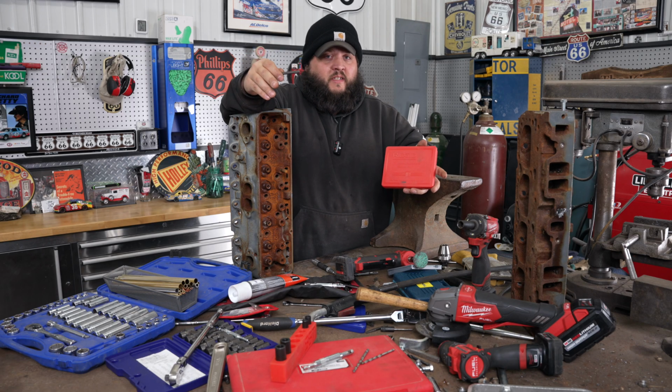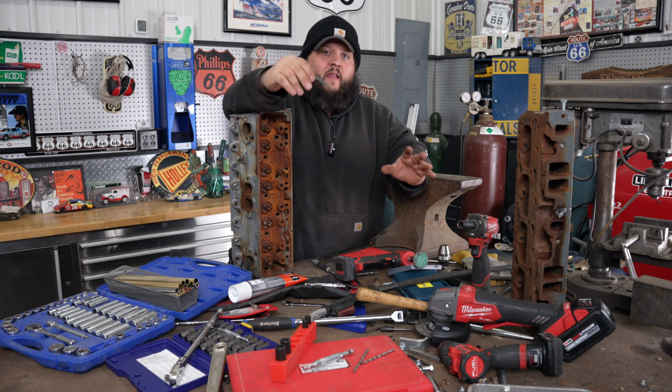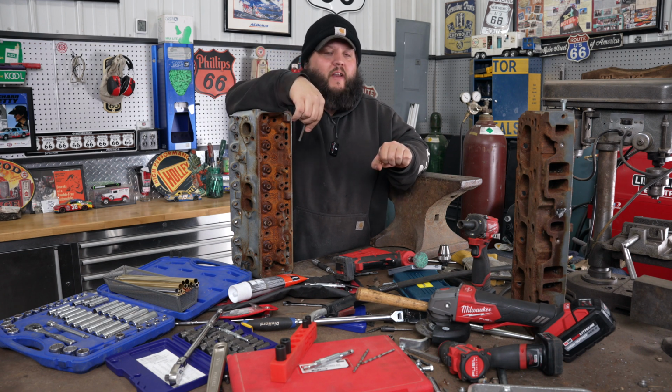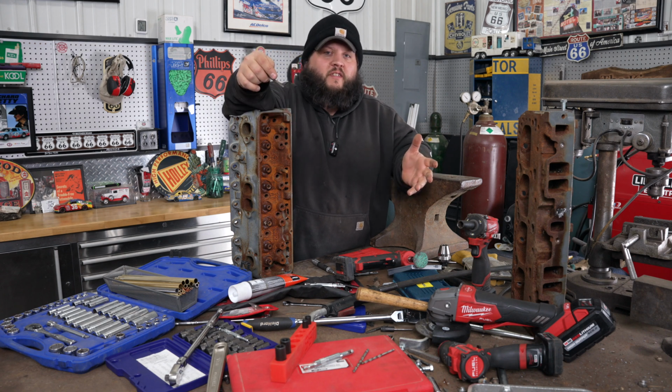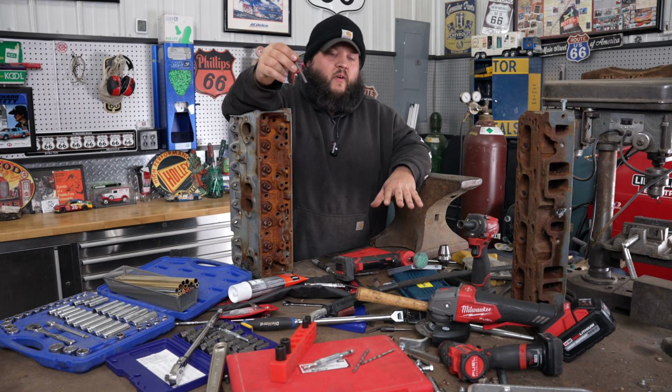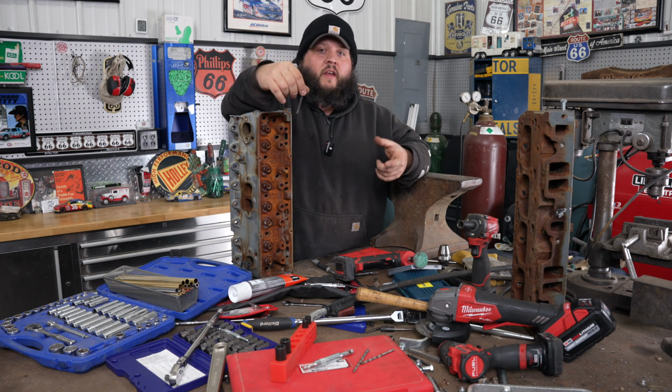Again, I don't use these in steel much besides brake fittings, mostly for brass, but these have always been really good to me. I really like the design the best. I feel like all the tapered ones wedge the bolt and push the bolt out into the threads and make it harder, and you're fighting yourself. I'd never quite understood the tapered ones. These are not tapered, they're completely straight. You want to drill your hole as precise as you can, and then you hammer these in. Then you slide a little nut on here and you turn them out.